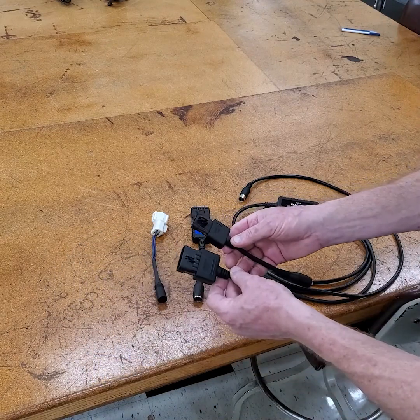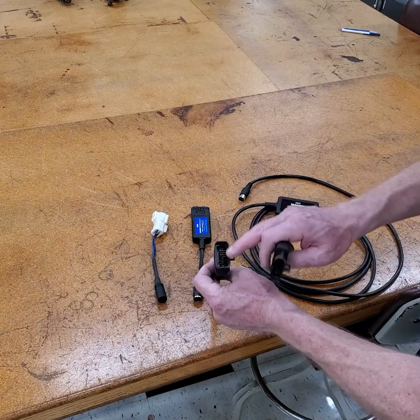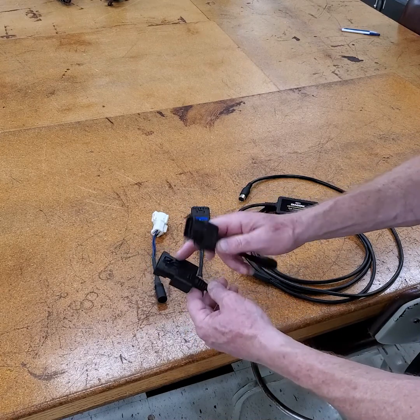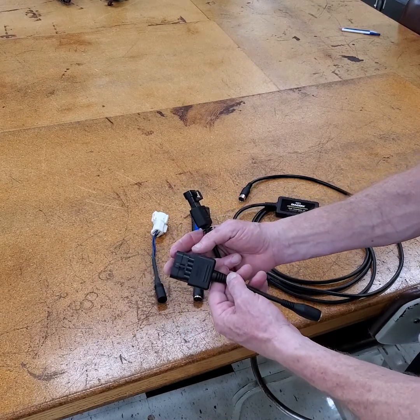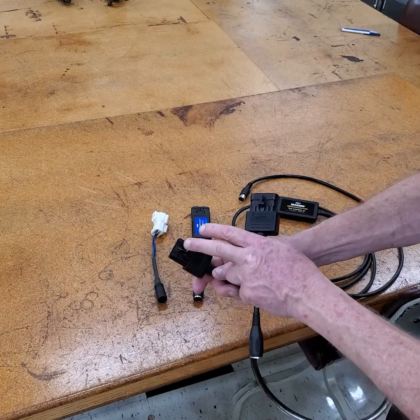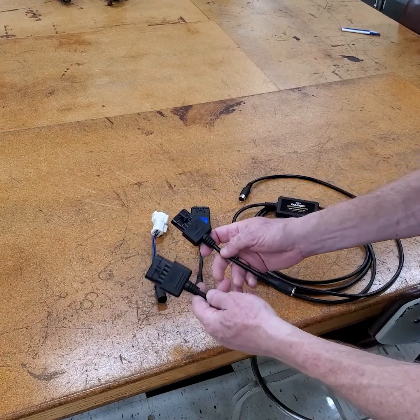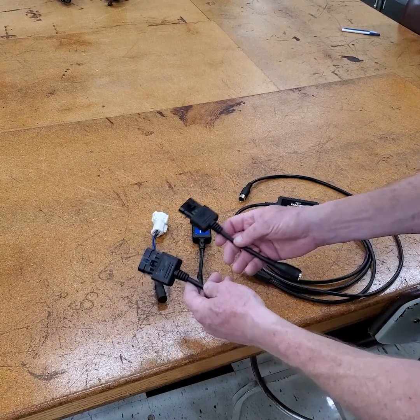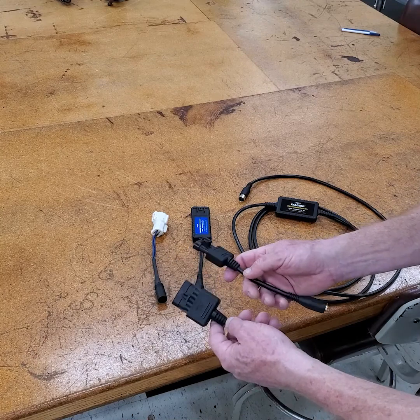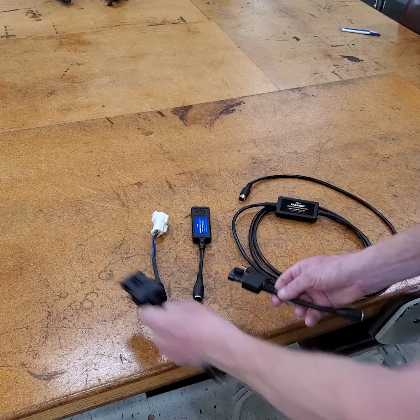When we look at the two, the other one also has four wires in it — there are only four wires. You have power and ground and then a twisted wire pair, which is your communications. Same thing here: two wires, twisted wire pair for communications. These cables are all what are known as serial cables, running on the 1587 protocol — the slower speed than CAN. So these are the early ones.